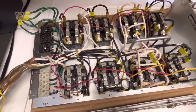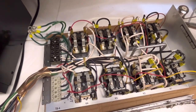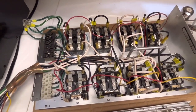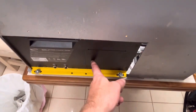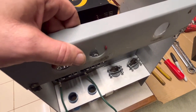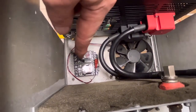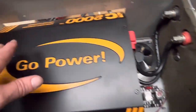So it'll activate the inverter circuit and swap these relays when it's on inverter, so you're not able to run air conditioners or whatever — you can only run the receptacles and whatever's connected to that system. We still have to get this remounted in there and the box put on. I had to cut out the sides of this box so it fits over these feet, and the other side has vents so it's able to vent from the side. It fits on here pretty good.